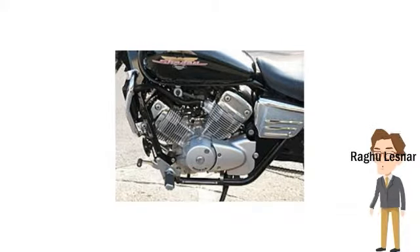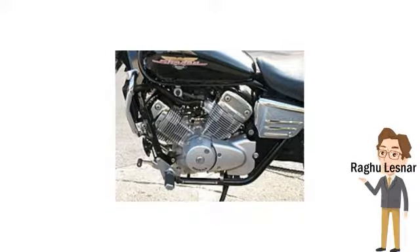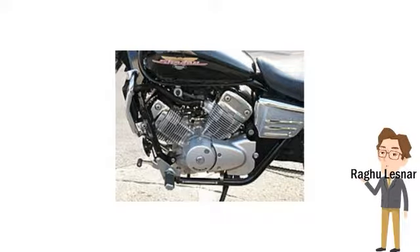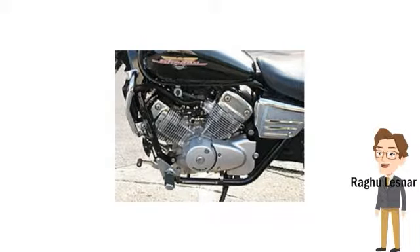This differs from a parallel twin-cylinder engine, which has distinct front, back, and sides, but the inside of each cylinder is not exposed to airflow as the cylinders are typically joined together with a cam chain running up through the block between the cylinders. Some transverse V-twins use a single carburetor in the middle of the V-angle to feed both cylinders. While this allows an economy of parts, it creates further cooling problems for the rear cylinder by placing its hot exhaust port and pipe at the back, where it may be exposed to less cooling airflow.